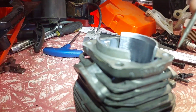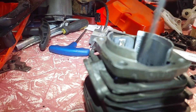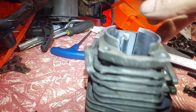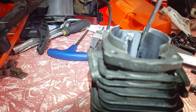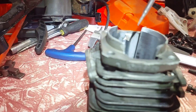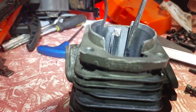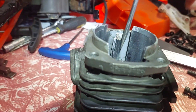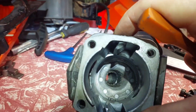Got to be careful because there are cylinder bolts going straight through — I don't want to go into those. But I want to open that part of the cylinder up to the actual window so when the piston is at bottom dead centre it actually passes that window. Otherwise at the moment, even when I open up this centre divider to let more air through, this particular transfer window — one of the biggest ones — is getting no real airflow.